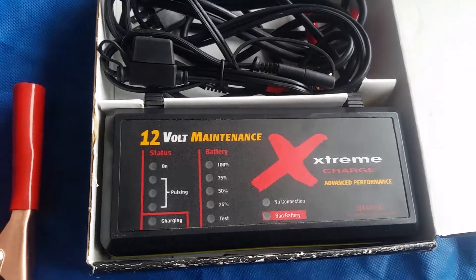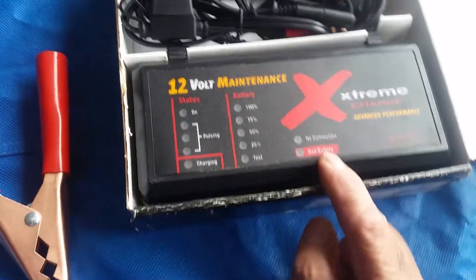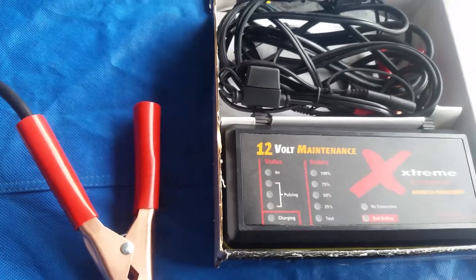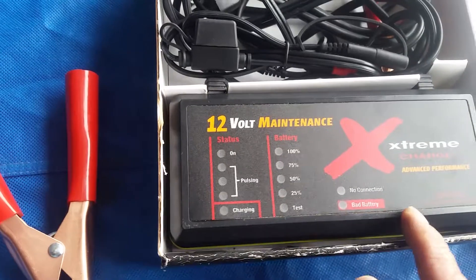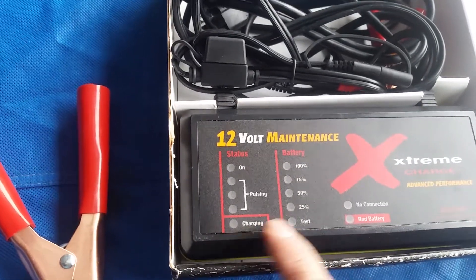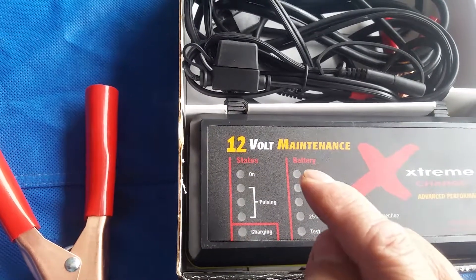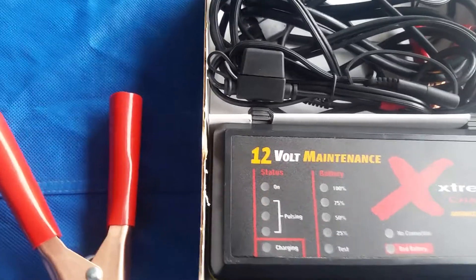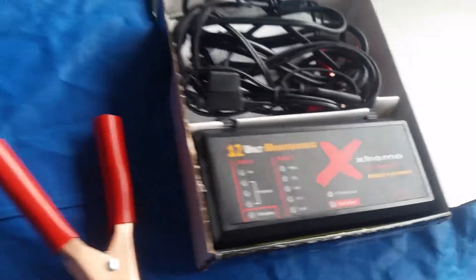Positive, negative clamp — just hook it up. Of course it showed a dead battery at first, so what you have to do is excite it a little bit. I put a little charge on it for about five to ten minutes, then hooked this up and it went straight to charging. It stayed dead with no lights, but after about a week it went to 25, 50, 75, to 100. After I hit 100 I let it stay on there for another two to three days just to make sure all the sulfates and everything were done.